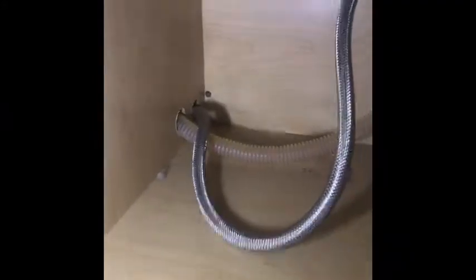So what you want to do next is make sure you turn the water off and then disconnect the water feed line and then disconnect your drain tube. Pretty simple. Slow process, but pretty simple. One other thing before I take this water supply line off, make sure you support the plastic line, because if you get on the screw and you try to undo it, it very well could break the water line. So just make sure you stabilize with both hands.